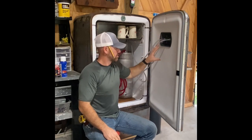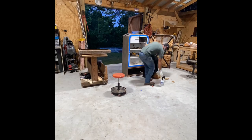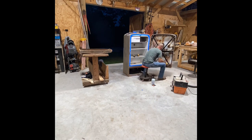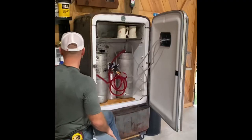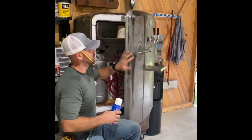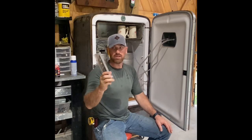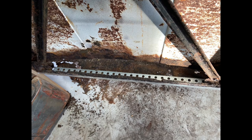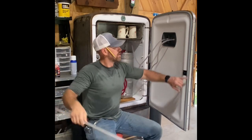When you move the panel on a lot of these old refrigerators, the insulation has sagged and settled and is no longer providing any R-value. I removed all the insulation, which let me get inside and rebuild it. As you see in the pictures, the bottom of this door was very rusted — you could put your finger through it. I sanded the heavy rust down, then used Permatex's rust treatment — a rust inhibitor — spraying it on the inside and the outside of the whole unit. For the bad structural areas at the bottom of the door, I used angle iron from Home Depot, cut pieces, and riveted it to the good metal that was left.